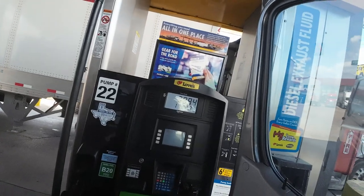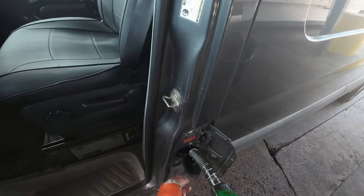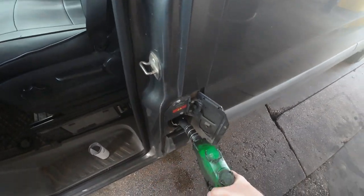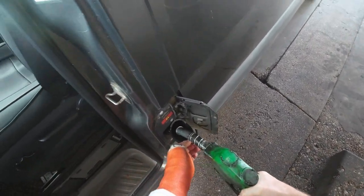Now that we have your oil maintenance covered, let's move on to fueling. I'm talking about truck diesel — specifically the pumps where all the large truckers go, not the regular diesel pump. These high-flow nozzles don't work directly with your sprinter: when you try to put that nozzle in and squeeze the trigger, it'll trigger the auto shutoff mechanism built into the nozzle. Fortunately there's an adapter that costs about 16 bucks, but for those who don't want to spend that, there is a two-dollar funnel option. Both work pretty similarly, so it's really up to you.